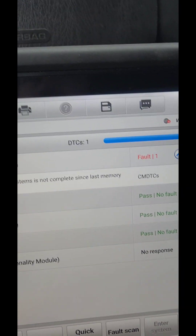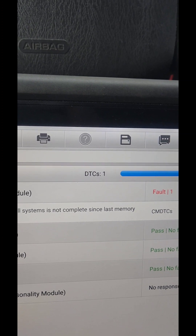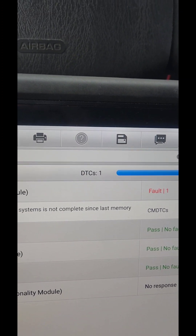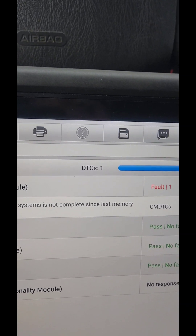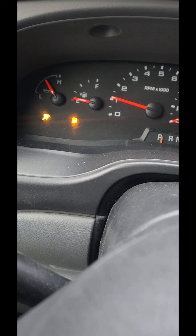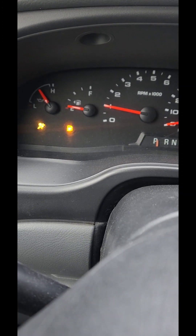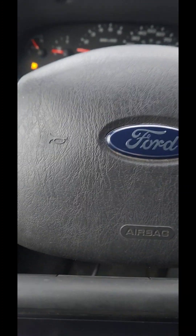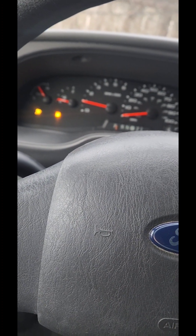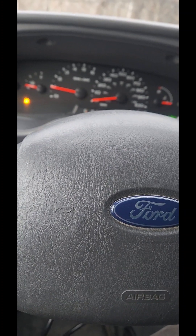Removing the tank is not that hard — just two straps, disconnect the fuel line, and be careful of the vacuum hoses going to the canister. Check engine light is off, no more check engine. It needs to be filled up, but it's going to run fine. If Ford sells the sensor separately, you can replace just the sensor with a Ford OEM part and that would work, but don't put in an Amazon, eBay, or AutoZone sensor. You're better off replacing the whole pump like I did.